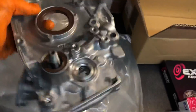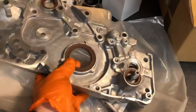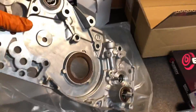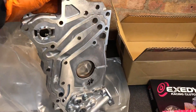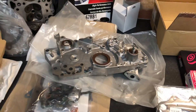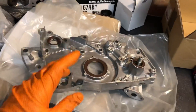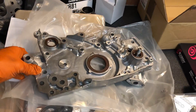You can see the oil pump has all the seals fitted. Because we've got the balance shaft delete, we're going to have to delete a couple of these and put a bung in them. Brand new, that's going to look nice on the block and we're going to have perfect oil pressures. We're going to get the oil pressure sensor put into that as well, so the ECU can shut down the engine whenever we get past the low oil pressure threshold that I'm going to set inside the Link ECU.